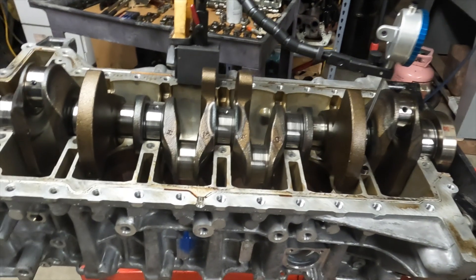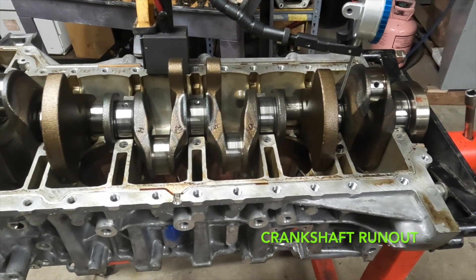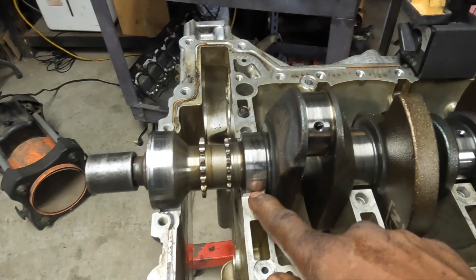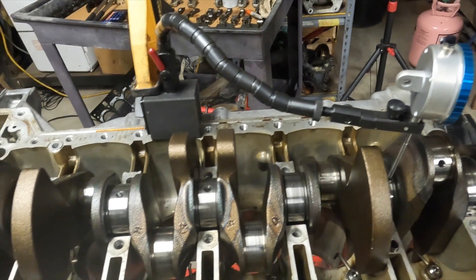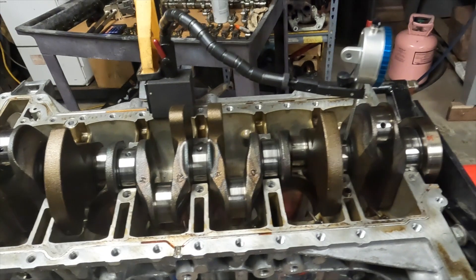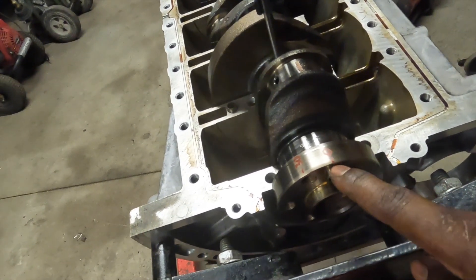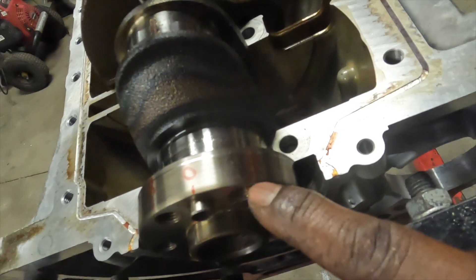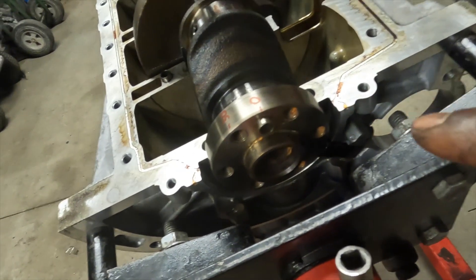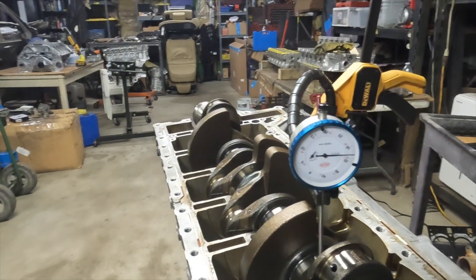Here we are with the continued teardown of the N55 and inspection. We've got the crankshaft inside the engine block and I've only put the two end lower journals inside to rest it. I'm going to take a runout inspection on the crankshaft to see if it's within tolerance or outside of tolerance, meaning that it's bent. I've aligned the dowel as my zero position. Dowel to the first bolt hole is 30 degrees and then from the first bolt hole to the second bolt hole is 60 degrees, so I've got degree positions all around the flange. I'll go around and take it and then we'll watch the dial indicator to see what our runout inspection shows.